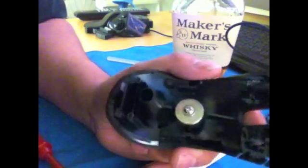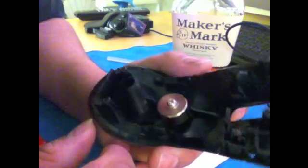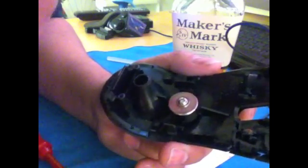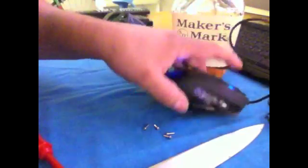It has a weight inside — I'm going to do another modification later to re-weight it because it's a little light and uncomfortable, and re-modify the whole top and side with a video too. But for right now let's fix the basic problems and make your Naga work. So once you've got that done, scratch it off, make sure it's all flush — because this is what's going to press your button down. Put it back together, it snaps back in. Now feel your click — you should hear your click. Click is perfect, just like the right one. It sounds like brand new again.